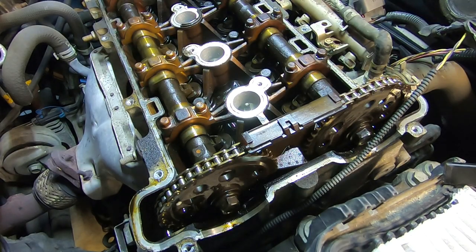I don't know the exact interval on this motor for when you should change the timing chain. If you let it go and it breaks while you're driving, you're talking big money. Your owner's manual should list this under maintenance — how often you should change the chain, if it's required or not. I would guesstimate that somewhere over a hundred thousand miles the chain should be replaced as a matter of routine maintenance. Although it would probably cost you a thousand dollars or more just to change this chain, if you let it go it could cost you several thousand dollars to replace a cylinder head.